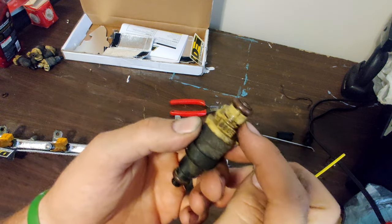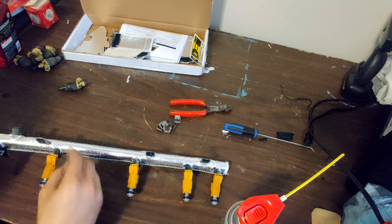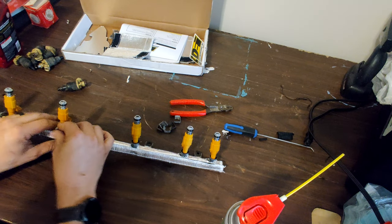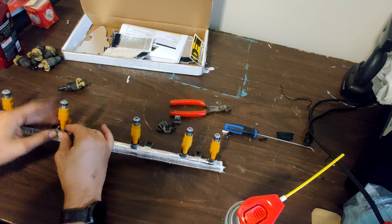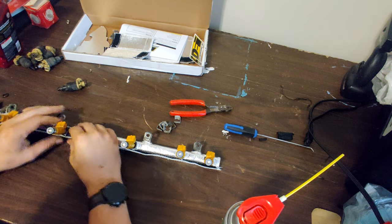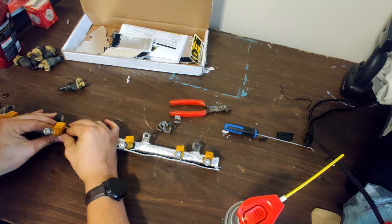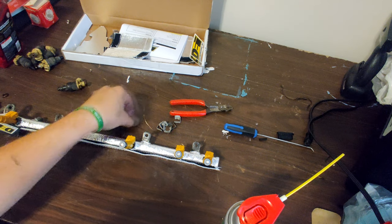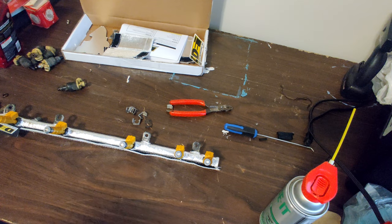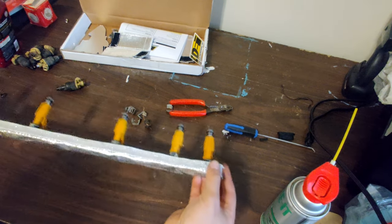I see where they used to sit. There's actually a part that's cut out to hold them. There isn't a part cut out on these Ford injectors, but I will put them in anyways, if I'm able. Yeah, I really don't see the use of putting them on, because they're spread out and they're not doing anything. I've heard a lot of guys don't even run those pins or those clips, because your fuel rail is bolted down anyways. So it really doesn't matter too much.